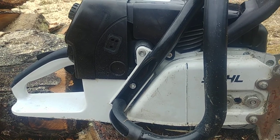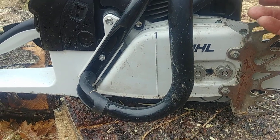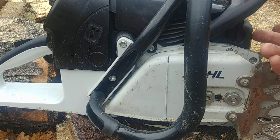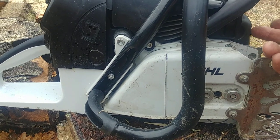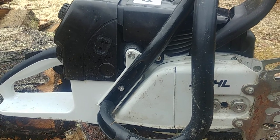Scotty Coons does most of his saws, but he did the testing on the 660s and the 661s, with the baffle in unmodified, the baffle in drilled out, and then the baffle out. And with the baffle out on the 660s is definitely better performance.